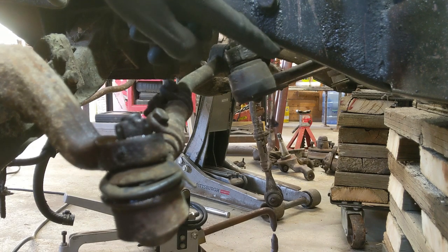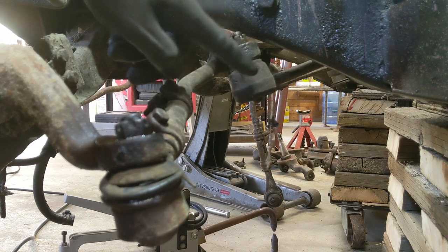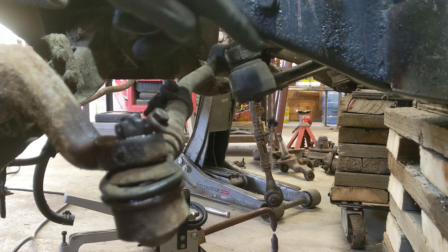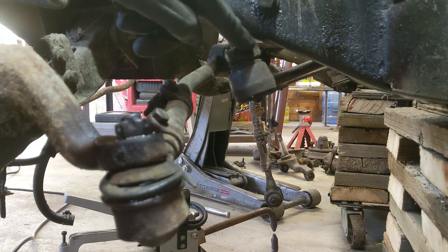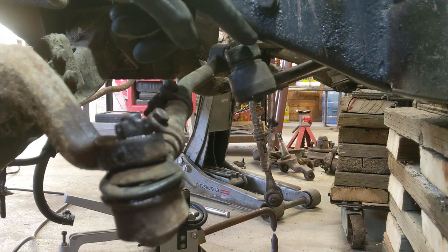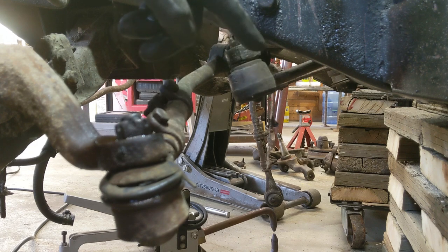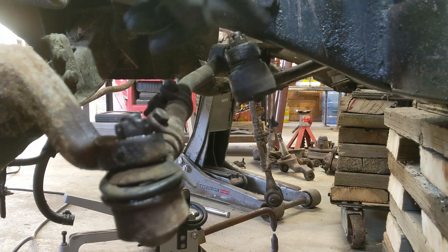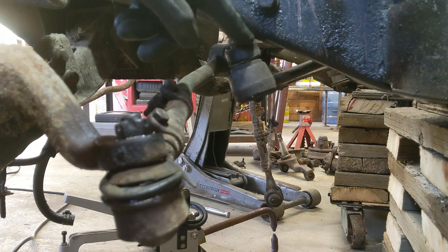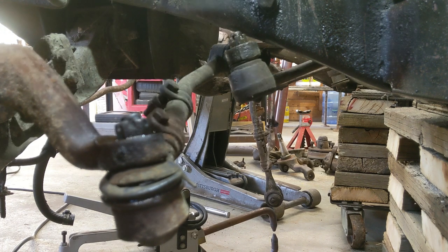Oh, and you notice I've moved it all this way because it gives you access to this pitman arm nut. But when you do that, remember when I plugged those steering box hose ports, you might want to put a bucket under this and a rag over top of it and take those plugs out, because when you move this, you're going to have fluid forced out through those ports, and same for going the other side, and it'll spray all over the place. And ask me how I know that, or how I remembered to mention that.